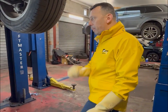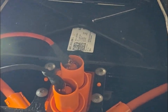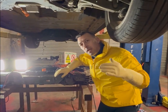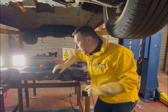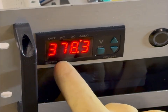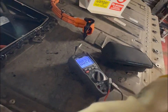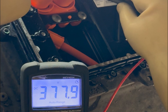It's a multi-purpose control unit distributing power and allowing power to go in when the vehicle is plugged in to be charged. When we measured it yesterday, we had 357 volts, so we did the math — it was probably less than five percent state of charge. When the voltage is that low the computer shuts down. We've already put it on charge and raised it to around 377-378 volts, and we're double-checking the voltage reading here, which confirms a similar reading.